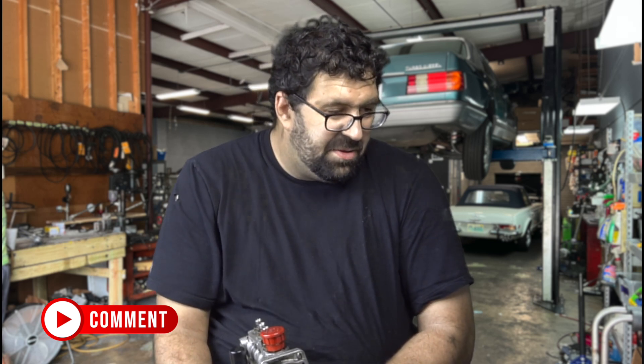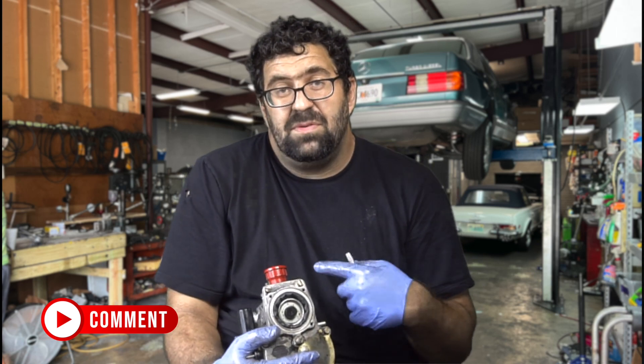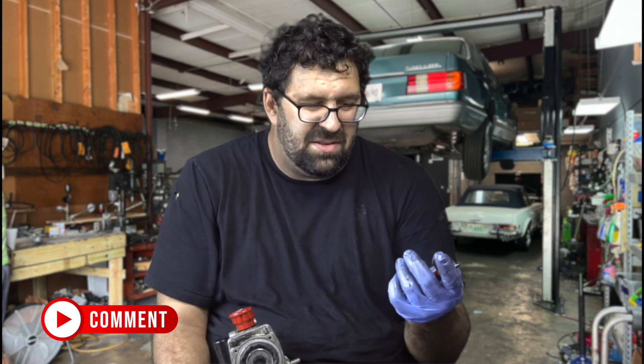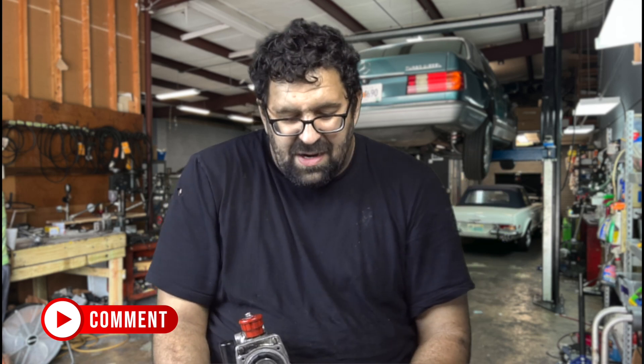If you enjoy this video please like, share, and subscribe, and tap the bell for notifications. We dropped our 300 SD W116 long-format video for Patreon members, and it'll be available to the public soon. If you're thinking of rescuing an older 115 diesel, remember to check this diaphragm and check the fuel rack to make sure the car will run like it's supposed to — it'll probably come right back to life. They're pretty good cars, and these issues do occur as the cars sit longer, but they usually bounce right back.